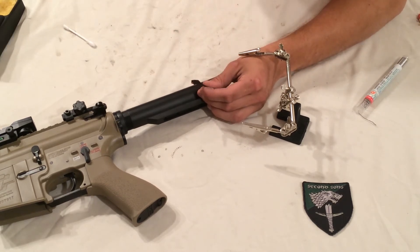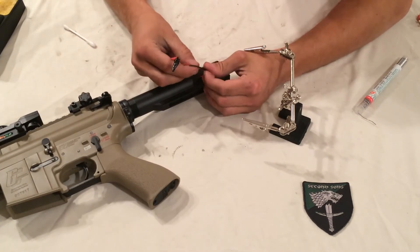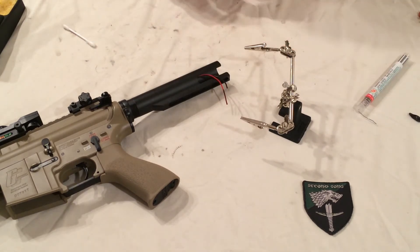I've already got the Tamiya cut off here. One thing to keep in mind is it's always good practice to cut them one at a time. It doesn't really matter on the gun side because there's no power source, but on a battery, if you cut both at the same time you'll cause a short and could destroy your battery.